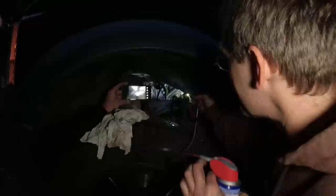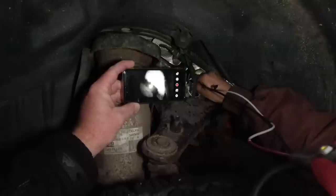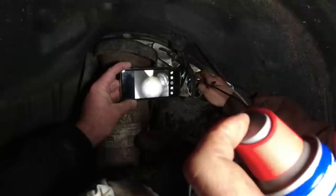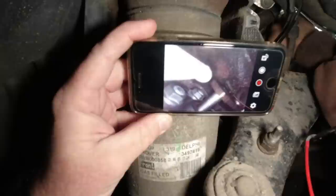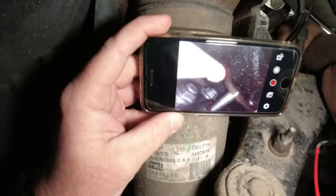That's the first ball. Yes. We're going to get this one all wet now. Look at that - look how it sucks in. Land Rover would have taken the body off for that. Okay, now we're going to dive in deeper. This was actually Joachim's idea. You can see that he's a paramedic. He knows about getting stuff into crevasses and getting it back out. This is the turbo actuator rod, and here on this end I can't get the camera closer - you can see the receiver. This is like the ball where the actuator rod is inserted. Now look at our setup. See how it sprays right into that ball? See right there? This is trenched in oil. So we got now both balls lubricated.